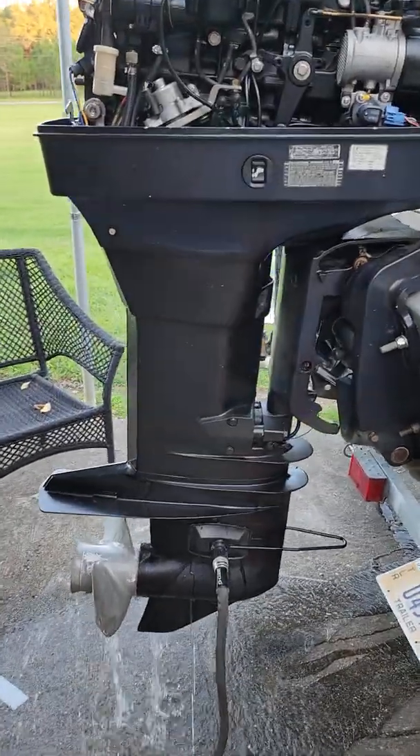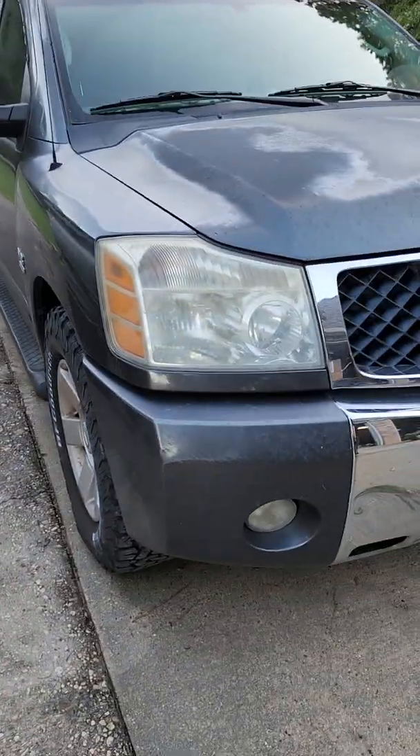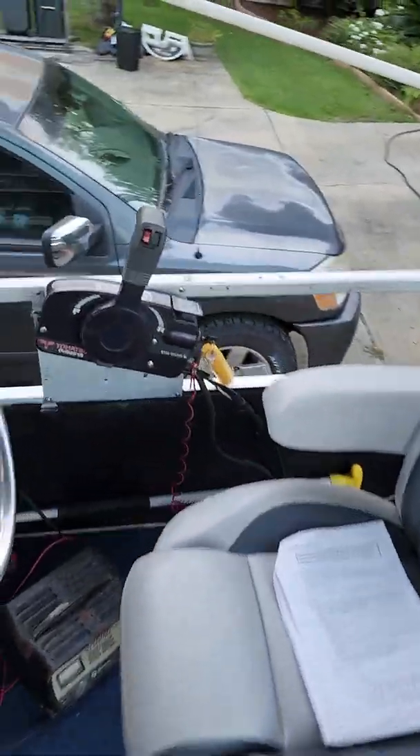You want that ECU to be able to see that you have replaced the TPS — the TPS is in a new position and it's supposed to be functioning. With that being said, once you've got it, turn your water on, make sure you've got gas — unlike me — pump your bulb, your throttle's closed, got good filters, and let's hope for the best. Here we go.